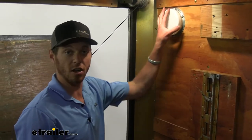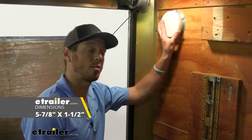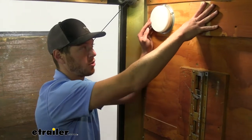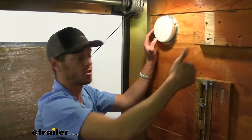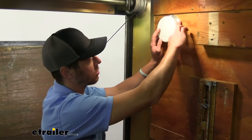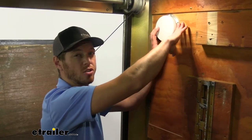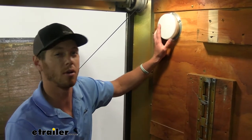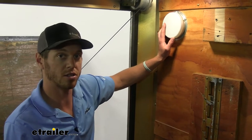The actual lens is going to be about five and seven-eighths inches in diameter, and it's going to stick off your wall about an inch and a half. So if you have some two-by-fours on your wall, it's not going to stick out any farther than that, which is always a plus — you're not going to bump into it. The mounting holes on center are going to be about four and three-quarters of an inch, and this is going to be for your 12-volt DC systems. It's going to pull about 0.4 amps and it is a one-wire system.